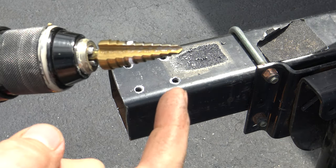That's how you use a step drill — this hole is now at one-half inch. Go ahead and continue that on the four top and four bottom holes. If you don't have a step drill, just continue stepping up your drill sizes all the way to half inch. Now, drilling the four holes in the bottom is the hardest part of this whole job. The tongue part you cut away is easier because you can flip it over and always drill from the top. I suggest you wear a jacket or sleeve because the chips are going to fall on your arm and they're very hot. If you're going to be right under it, also use a face shield.